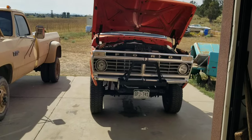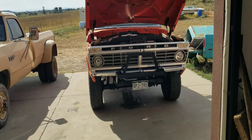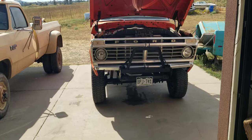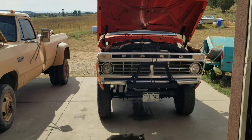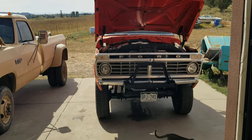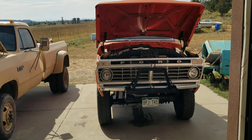So anyway, what we're doing with the high boy — this is my wife's. It's got an LL swap kit. It has a mostly stock 460 that we got out of a '78 250 that a tree had fallen on. We just cleaned it up and put a 214, like 500-lift cam in it. It's got a Performer and a 750 Brawler on it.